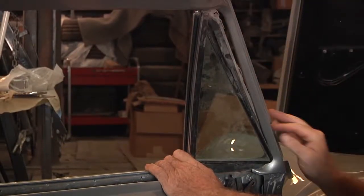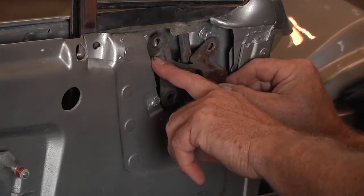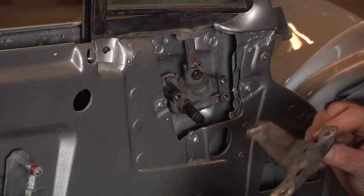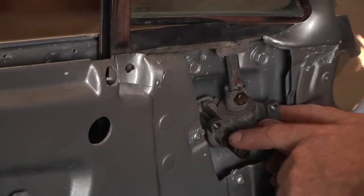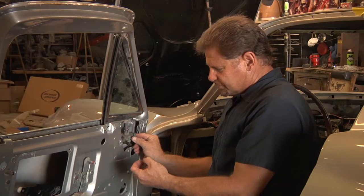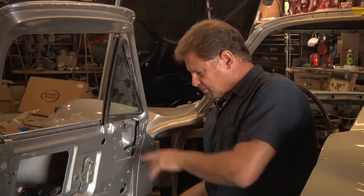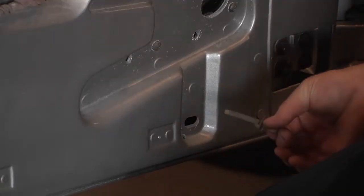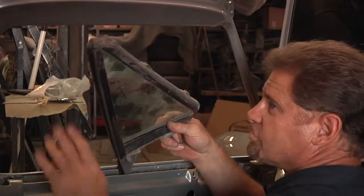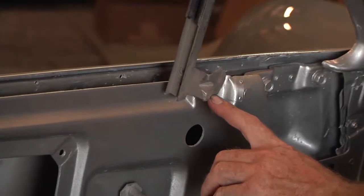The wind wing has four screws holding the top side. We have three bolts holding the bracket for the transmission holding the wind wing — one, two, and one on the bottom through the hole is three. When you remove those, take off the bracket. There's a 7/16s bolt holding the transmission, which is the actuator for the wind wing. Remove that bolt, take the transmission, slide it down off the shaft and pull it away. There's a screw down below for the pitch of the wind wing — unscrew that and take it out. Slide back the wind wing on an angle, slowly pull it up making sure you don't scratch any paint. As you pull it out, give it a little twist — there's a small bracket for pitch adjustment. And that's it.